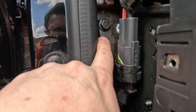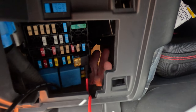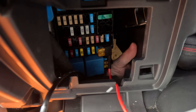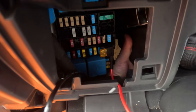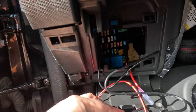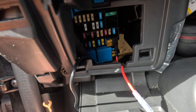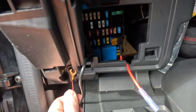Okay, so you can see the cable running down here under the glove box and up, and there's a space here that's easily accessible. So I'm going to mount the transformer onto here. I'm going to find something sticky, like some Velcro, and mount the transformer here, because there's all this excess cable as well, so we've got to do something with that. And then I've undone the ground connection because I'm just going to feed that back under as well, so it's tucked out of the way.